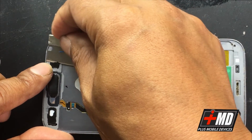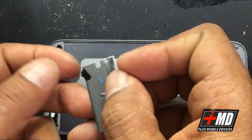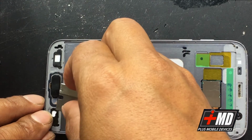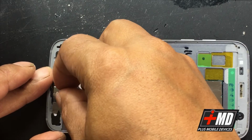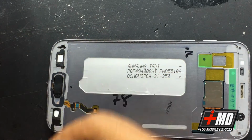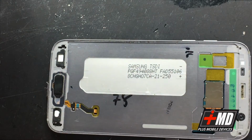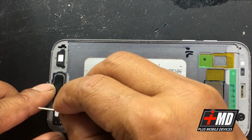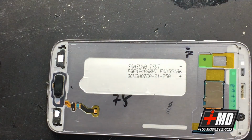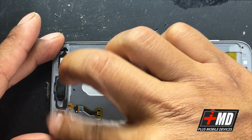This is a double-sided adhesive, so we want to activate it, and what we do is we slowly shave the top painted layer off that was on the previous LCD, and we're going to apply a little hint of alcohol to reactivate it. And again, I'm just shaving it lightly. You don't want to go too deep that you actually rip the flex cable or cut it. You just want to activate the LCD adhesive. Alright, so now a little dab of alcohol in this area here, 99.9% alcohol.